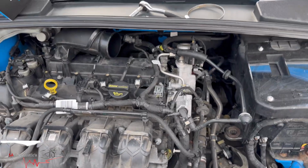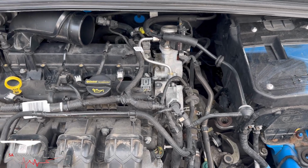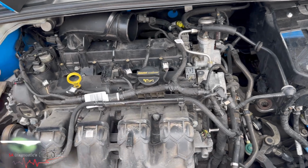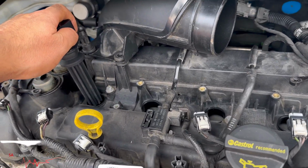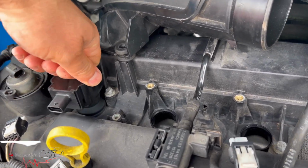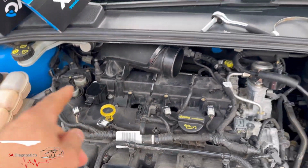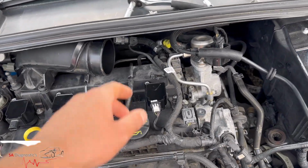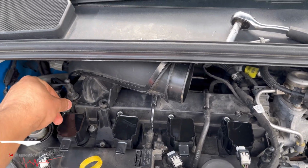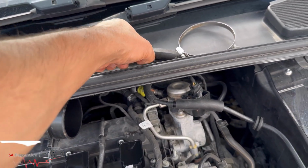The spark plugs are all in, all tightened to the degree they need to be, and then I'll pop these on. Like I said, it's as simple as just literally doing that in there like that. Just make sure you give it a good firm push there. And then we'll do the same on the next position. So if we remember, that was for the end one. Okay, just use your fingers first, pop them on.